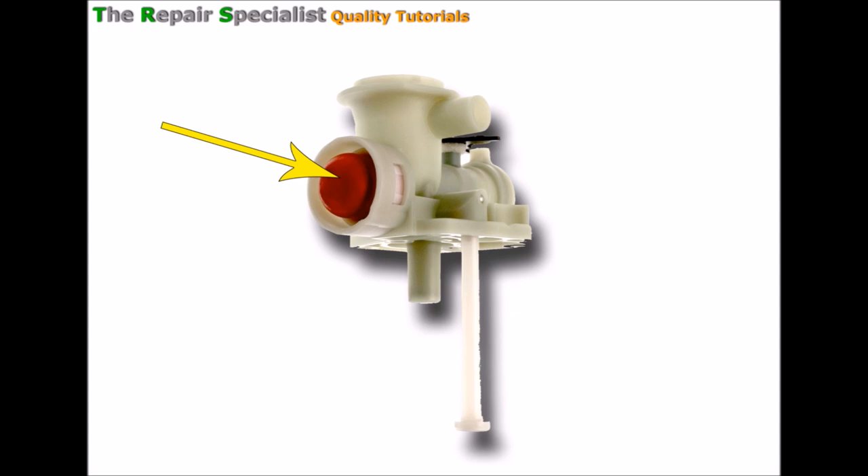This is the main jet. And then we've got the breather pipe there, which connects the breather from the engine into the inlet. This part here is the throttle lever, which operates the throttle butterfly within. The main carburettor body here — the whole thing is made of a hardened plastic, which again is quite unusual for a carburettor. At the moment I'm showing it in an isolated capacity.